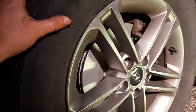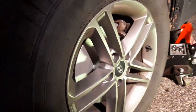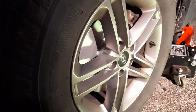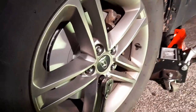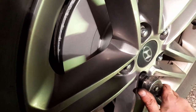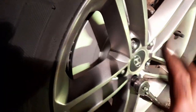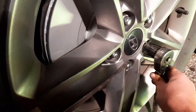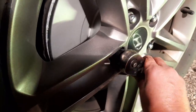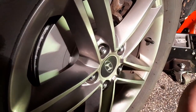Put the bolts back in. This rim is very very tight — there's no play at all, zero — and sometimes it's hard to come off so you gotta kick the tire. When tightening the nuts, first do it without putting it down so the wheel seats right. Do this one then the one on the opposite side, and once they're nice and snug let it down — that way the tire goes right in.